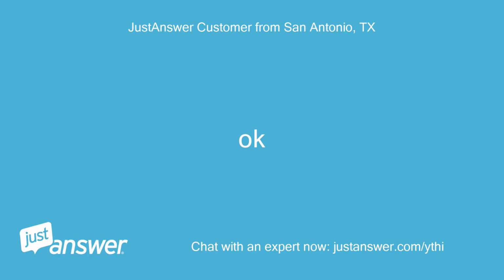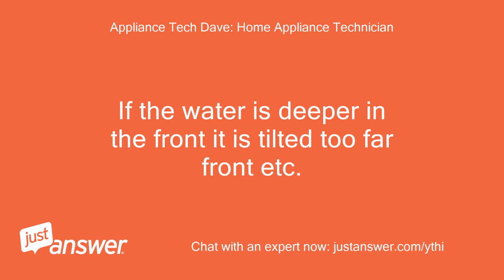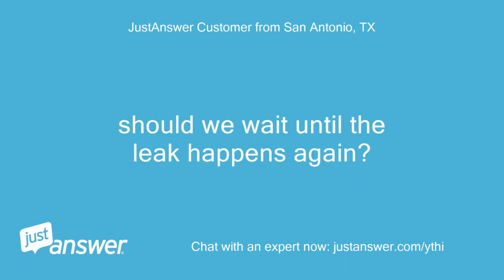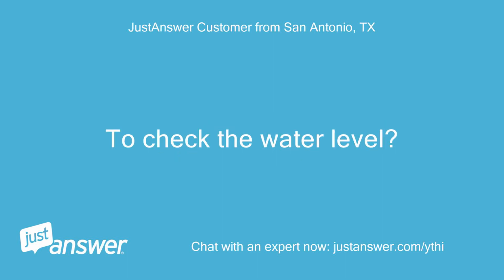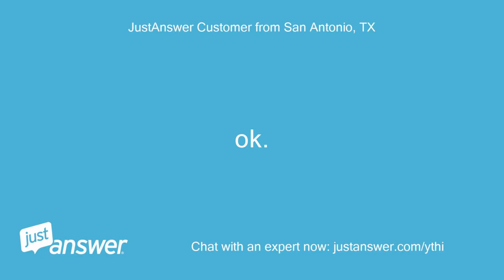Okay. What do we need to look for? If the water is deeper in the front, it is tilted too far front, etc. Okay. Should we wait until the leak happens again to check the water level? Anytime the DW is washing, you can check water level. Okay.